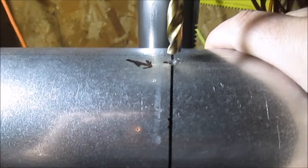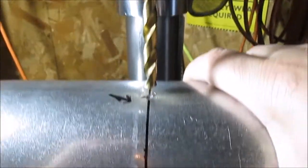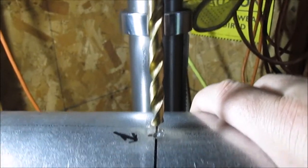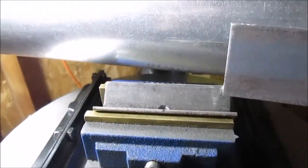So we're right on the line. So do that at your own risk. Or like in another video I showed, bring it down with pressure and then turn the chuck by hand. That way you can just, no starter bit, drill the hole you're going to need, 5/16 on this one. I think you see what I mean. Got a little V-block in there. Okay, back to work.